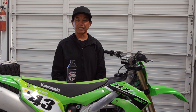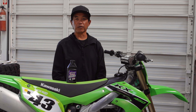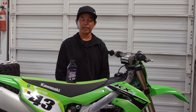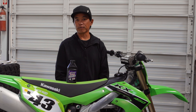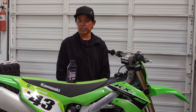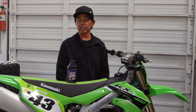I've gotten good at it on the Kawi because a few years ago Kawasaki outfitted the bike with an oversized rear rotor, and not so much on practice days but on race days — maybe it's nerves or something — I always tend to drag the rear brake a little bit and kind of cook the fluid. I used to have to come in from practice and bleed the whole system. Replacing your brake fluid is something you should probably do every couple months regardless, as obviously brakes are a very important part of riding motocross and off-road, and the fluid does get hot and wear out and lose its effectiveness.